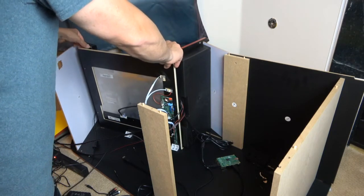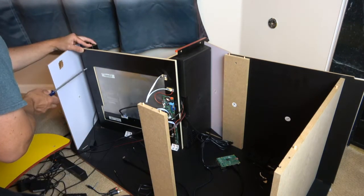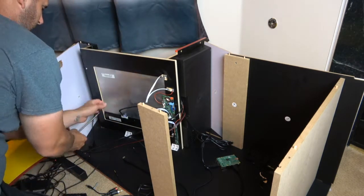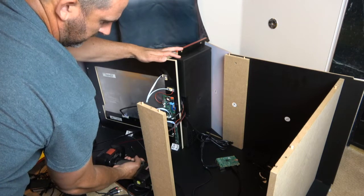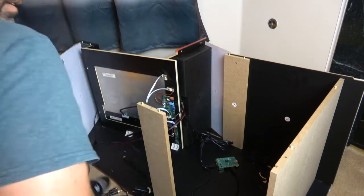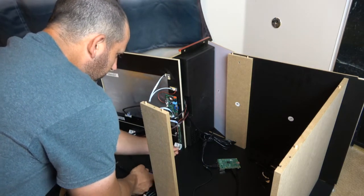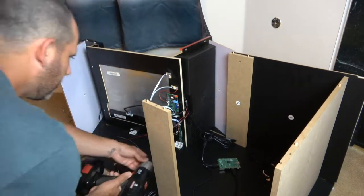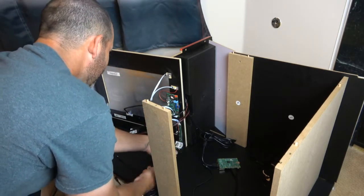The two screw holes up top are pre-drilled, so you can just take the screws you removed and put them right back in through there — it goes into that little board that connects to your marquee. After that you just have to pre-drill the little holes that go into the monitor. Be extra careful that you don't drill all the way through the monitor. That's the only point where you can really mess something up. Once those are pre-drilled, just put those same screws back in.